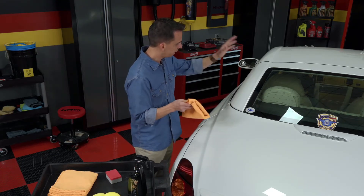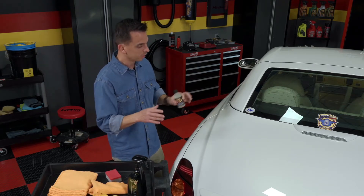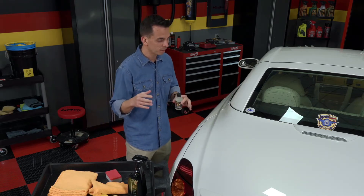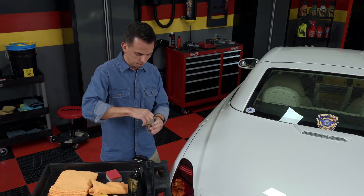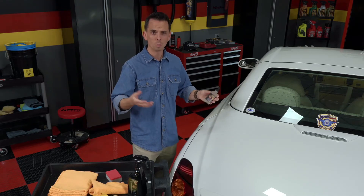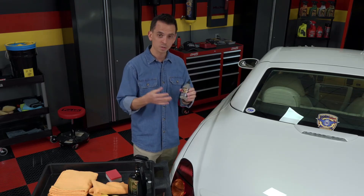You repeat this process over the entire vehicle after you finish polishing it. When it comes time to apply the actual coating, ironically, this is arguably the easiest step for the whole job. When we hear coatings described as lasting five, three, or ten years — or even permanent — we often get apprehensive, especially when we find out how much professional detailers charge. But the coating itself is simple; anybody can do it. This is a dropper-style applicator, and the reason versus a traditional liquid wax where you just squirt it on a pad is because this product is hyper-concentrated, so it doesn't take a whole lot.